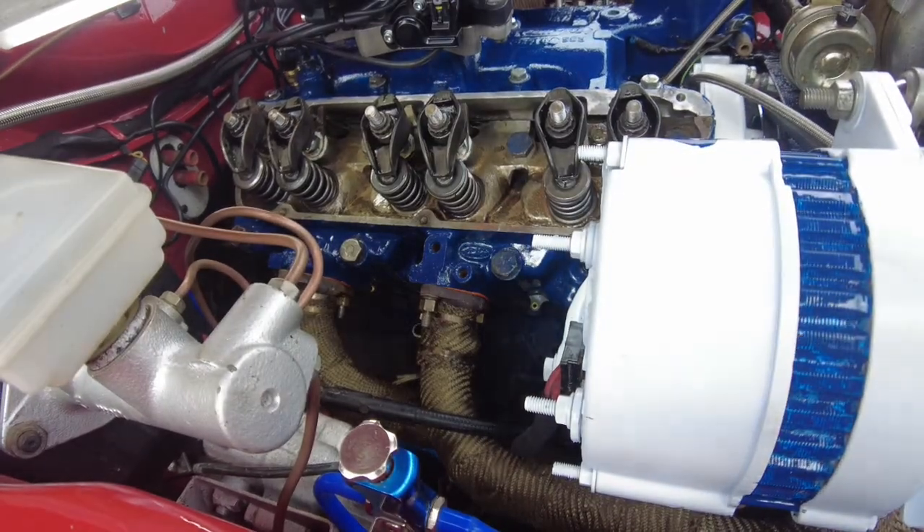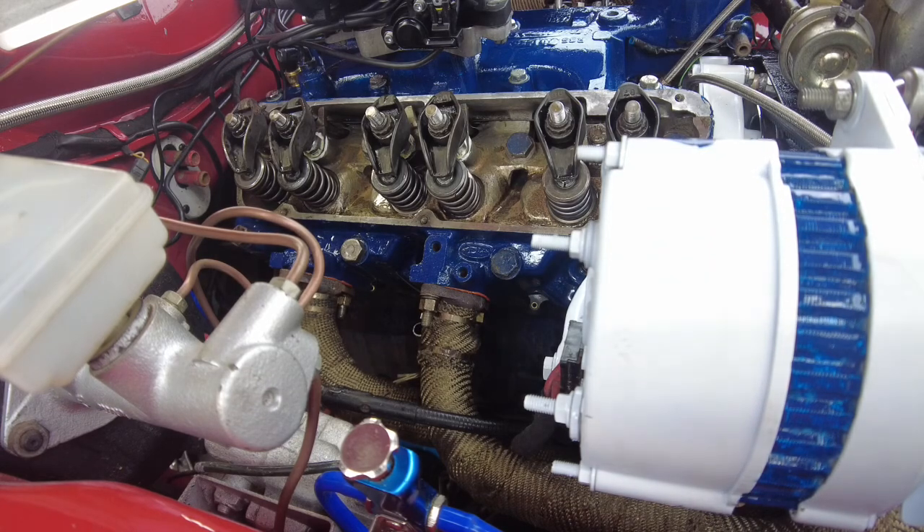We've now done cylinders one, four, and two. We now need to go over to the other side and do number three, but I still need to put all the rocker arms and nuts on that side, so I'm going to leave that there. I hope someone watching has found it useful. I find it a lot easier than looking through the book — I just get too confused with all the instructions. My dad taught me this years ago and I just find it loads easier. See you in the next video — hopefully this thing will be driving later on today or tomorrow.